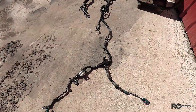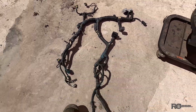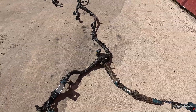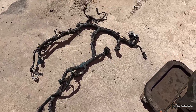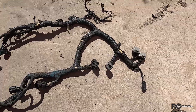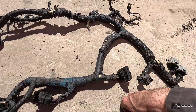I've been working on this engine harness for quite a while, just kind of off and on. As you can see, this thing is a disaster. That is exactly what happens when you have all these oil leaks on these machines — that oil just soaks the glue and everything for the tape and it deteriorates everything way quicker than it should. This one was such an oily mess I actually put the whole harness in the ultrasonic cleaner to get all the grease and oil and dirt off. Typically I would not recommend putting your entire wiring harness in water.